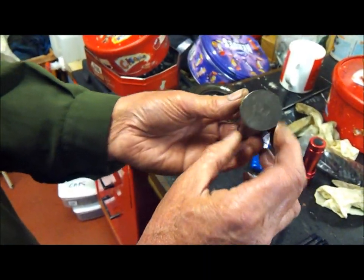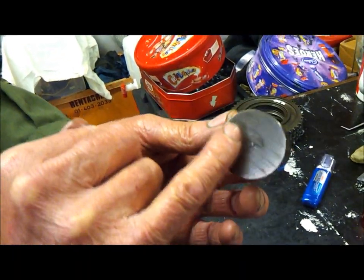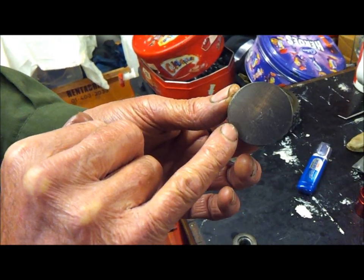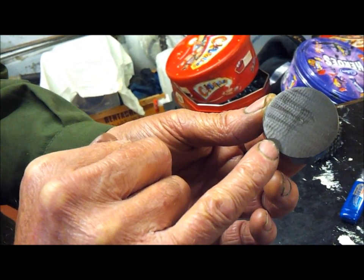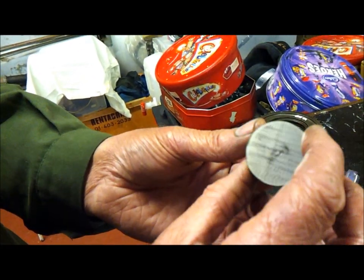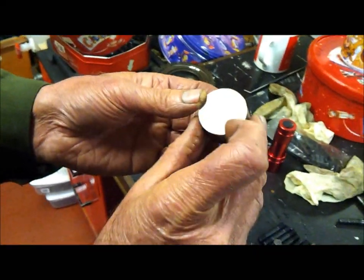As you can see, that particular tappet was not revolving correctly, and the chatter marks on top of that tappet were probably caused by the fact that the valve was just starting to touch the piston, creating a bounce condition on the tappet that was making these marks as it came up and hit on the camshaft.